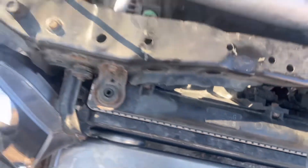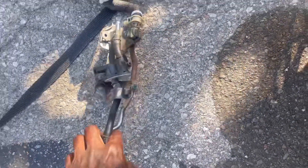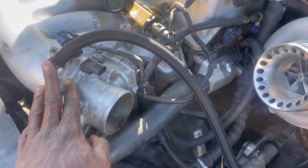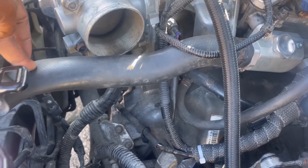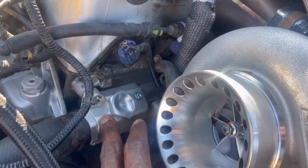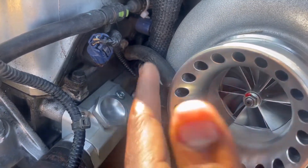The spacing is pretty good — right now it just clears the fog lights, so I'm actually kind of happy with that. There's also this brake booster line with the evap that I deleted — shout out to the man for coming by and giving me some stuff to do and delete. I ran a new AN dash-eight line to the brake booster and it runs all the way up to the RBC feeds. I also utilized the stock radiator hose, cut it shorter for the K-Tune upper coolant housing, because you have to get rid of it since the turbo sits really close.